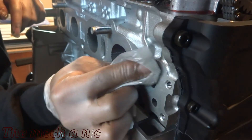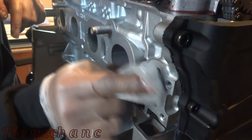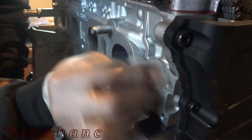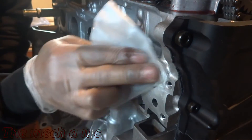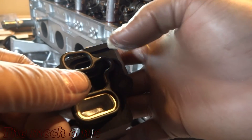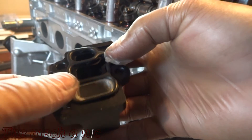Once the silicone is 100% dried I'm going to replace them with some actual nice bolts. The oil pan is completely installed. Because I can't resist, I'm going to go ahead and install another part just to see how it looks — but if I'm putting it on I might as well put it on for good. So I'm cleaning up the surface before going any further to get the paint off.